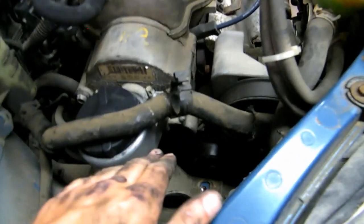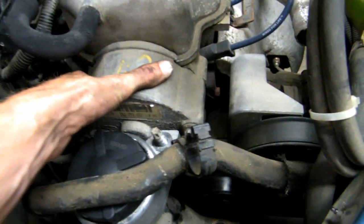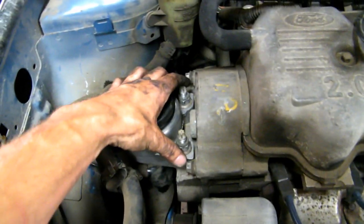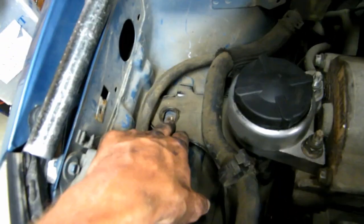Also, with the plastic cover, install it with the 2 top bolts loose, and then this bracket actually slides underneath the cover. When these nuts are tight, lower your engine very, very carefully so that it's sitting, and you probably won't have to line it up, but there's a chance you might have to use a pry bar to push the engine side to side, or get a friend to hold it as you lower it. It's not too hard.